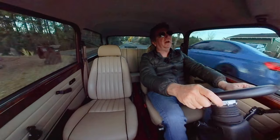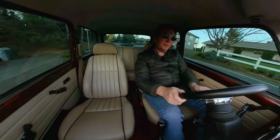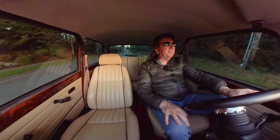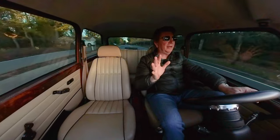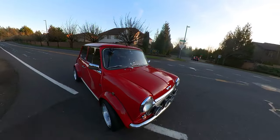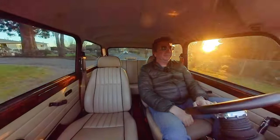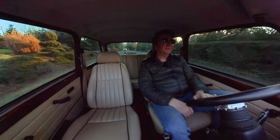I spent an incredible amount of time setting up the suspension. I corner-balanced it — we have corner weights in the shop and we've got 50/50 distribution between the front and rear totally dialed. The caster, camber, and toe front and rear is absolutely spot on. I always knew I'd be taking long trips with my wife in this car. This car is such a hit everywhere we go — if you don't like attention, don't get a classic mini, because when you come out of the grocery store there are eight people standing around your car asking a million questions. We call it the rock star car for everyday people.